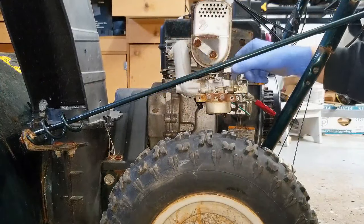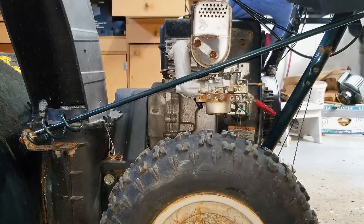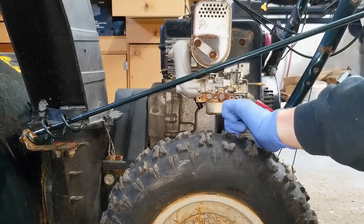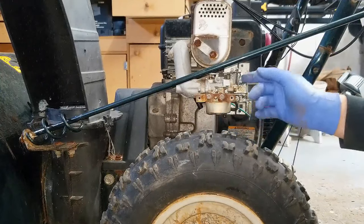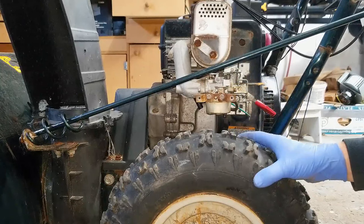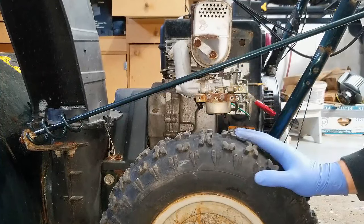The primer is working. Because the fuel currently in the carburetor is pretty bad stuff, I'm going to shoot some starter fluid or carb spray directly into the carburetor to try and get this thing to fire up. If it runs on just that starter fluid, I'll know for sure it has spark, it has compression, and this is a viable running engine.